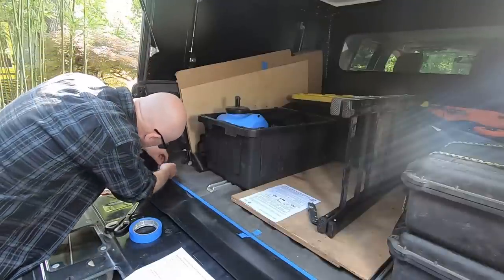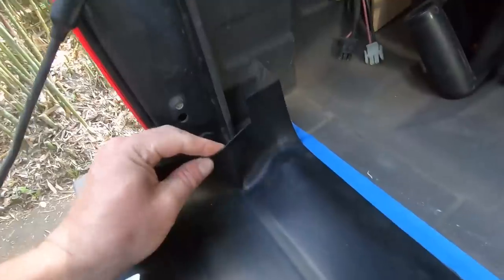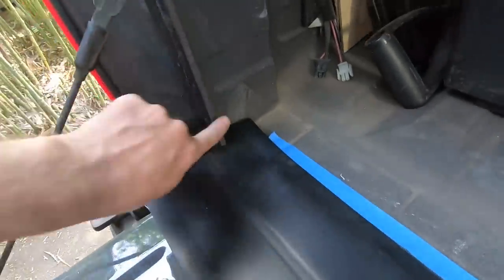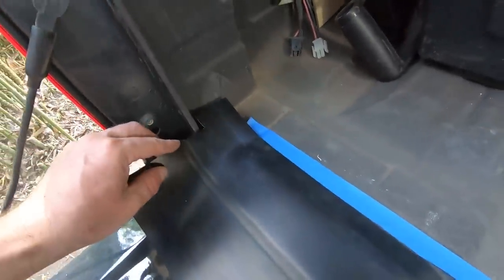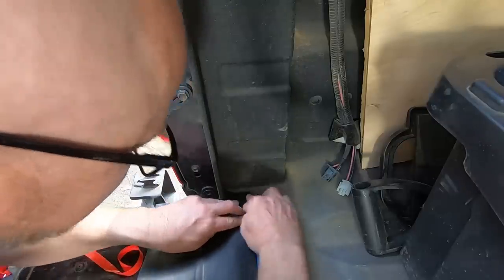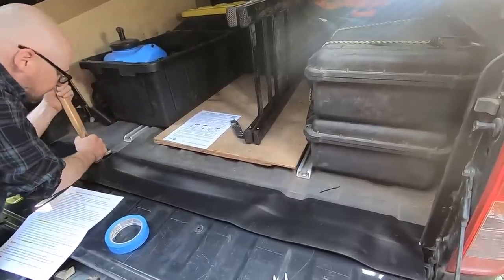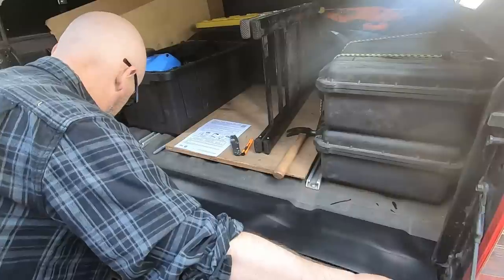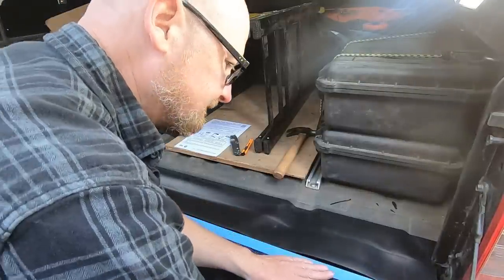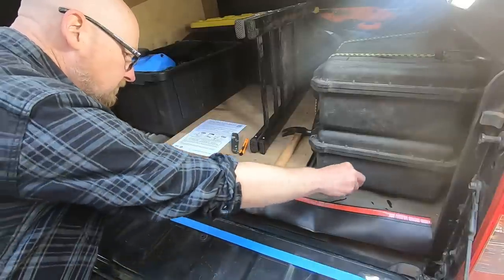I used more tape to mark where I needed to cut the ends to fit the tailgate frame. I cut a little notch in mine because of this sort of rib that sticks out here, and hopefully that's the right thing to do. The instructions suggest using a roller or a hammer to go back over the adhesive with additional pressure. With the truck bed side done, it was basically the same process for the tailgate side: make a reference line with tape, apply adhesion promoter, work outward from the middle, and trim as needed.